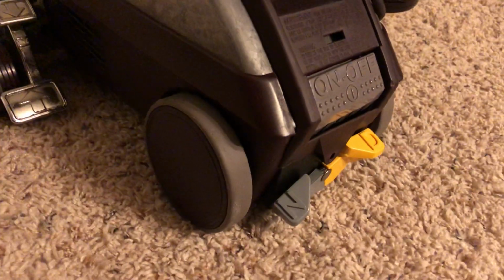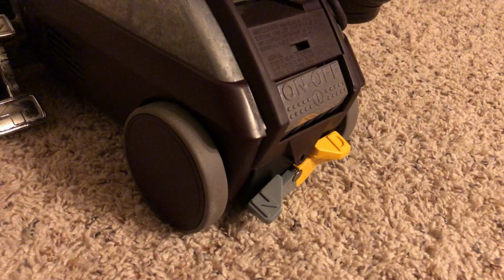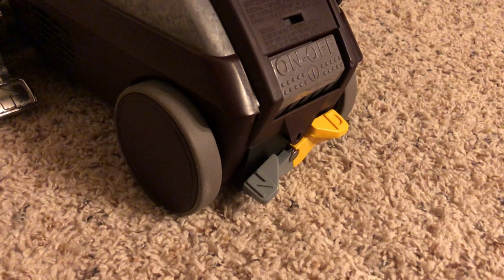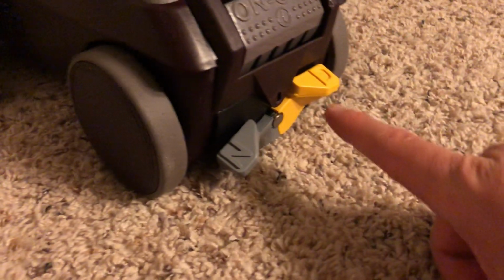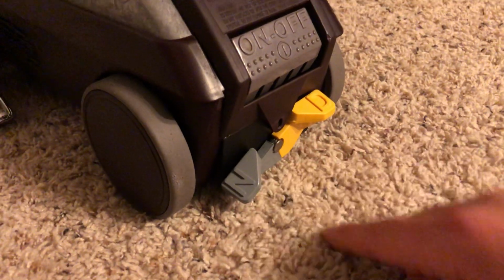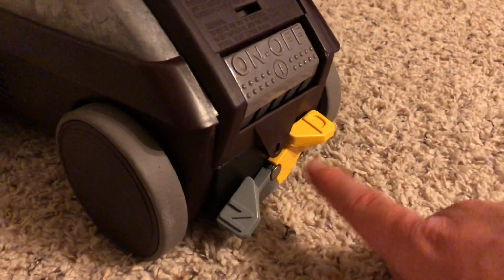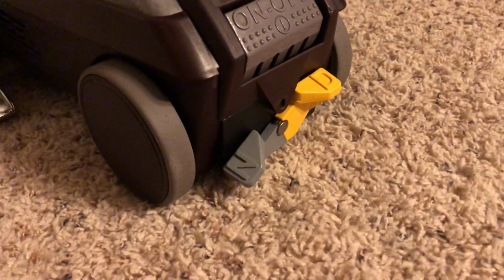And this is one of the newer transmissions that got the plastic gears, so it is a lot quieter. It just sounds like your newer Centria or Avalir style transmission that barely makes any noise, which is a nice plus. But unfortunately, you get this yellow colored drive switch like a G6. As you can see, the black colored switch plate is basically what would come on a G6. It's not green like the G5s normally have. Believe it or not, I actually have the original switch plate right here. As you can see, this is what the switch plate normally looks like.